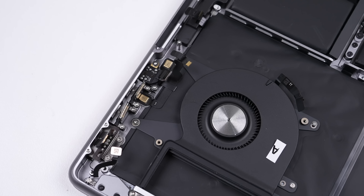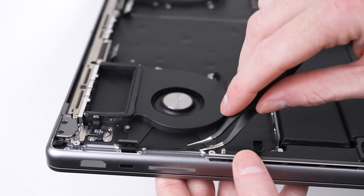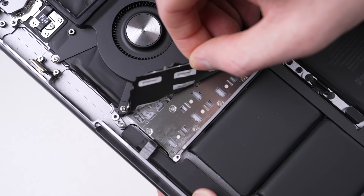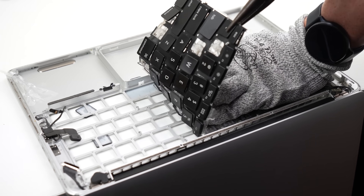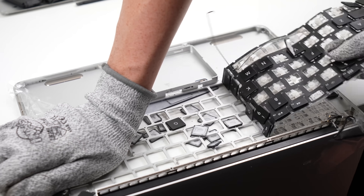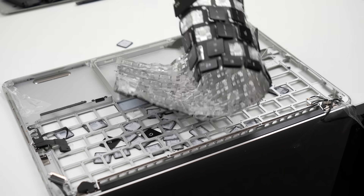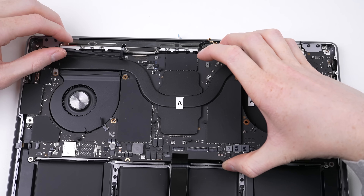There it is — a MacBook Pro with Apple's M1 Pro, 16GB of RAM and a terabyte of storage. Unfortunately, there's nothing to repair or upgrade here. With it out, we can see the fingerprint reader and its flimsy cable — this would be so easy to tear if you're not careful. We can also get a look at those replaceable ports; you do have to remove the board to access them, but this is by far the most positive thing from a repair standpoint so far. Having a peek at the keyboard I did see a screw, but digging deeper I found dreaded rivets — a common practice in MacBooks since 2012. Older MacBooks used screws for the whole keyboard, but what I believe to be a cost-cutting measure makes replacing the keyboard almost impossible, requiring the whole top case to be replaced instead, which is significantly more expensive.